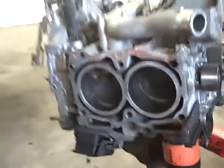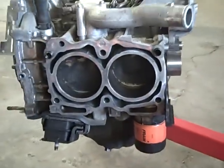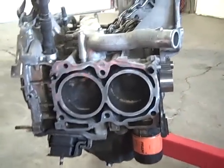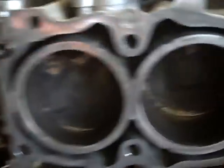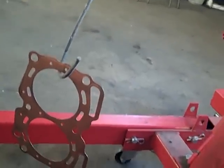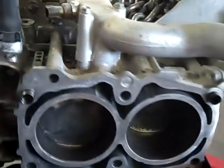I'm going to show you how to do the cylinder head install on a Subaru motor. These ones are a little complicated — there's a lot of steps to it. I recommend getting the manual; sometimes AutoZone can print them out for you. First thing you want to do is make sure that you have a really good clean surface to mount to. Get your new gaskets — I like to coat mine in copper spray-a-gasket, that's a Permatex product. Once you've coated them, you line it up.